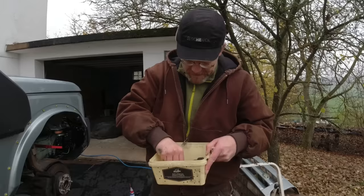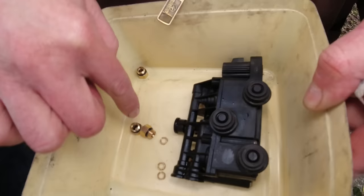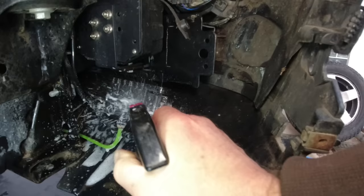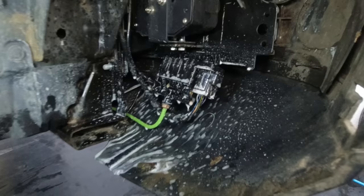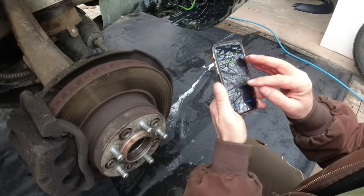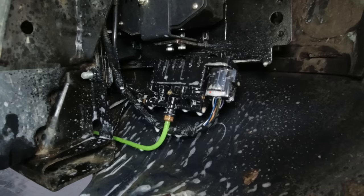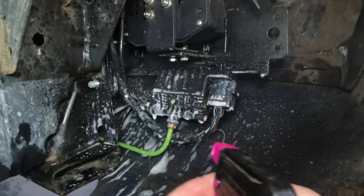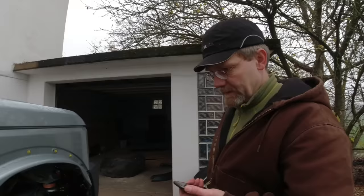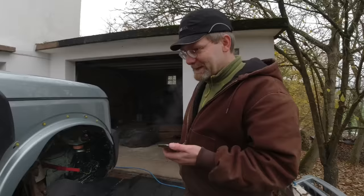We're done here. These fittings — put them in a plastic bag and keep them in your car as spares. The old air valve is going into our hall of fame. What I'm basically checking is that there's no air leak because the valve is now being actuated. There's no air leak. So we've got to put the vehicle back together here in the front — there are no air bubbles coming out, which means the leak is fixed. At least for now it's fixed. As soon as the car is back together, we've got to get our bi-yearly TÜV inspection and hopefully we're going to pass.